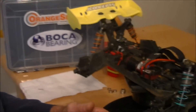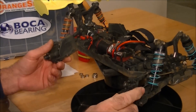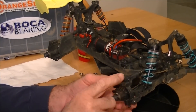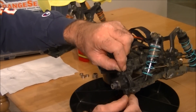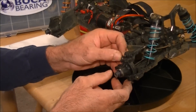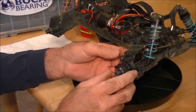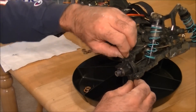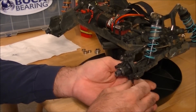To get started we're going to remove the front hub. To do that, we take the upper and lower pivot screws out — the fasteners — and also the tie rod, the outer tie rod screw. For purposes of time management I've already loosened all this stuff up so all I've got to do is pull it loose and pull it out.